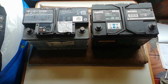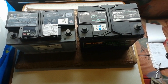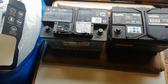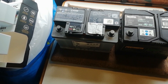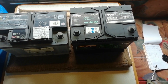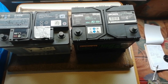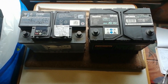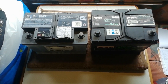The answer is that the car battery is more like Usain Bolt, whereas the leisure battery is more like Mo Farah. The car battery is designed to kick out a lot of energy over a short period of time while cranking the starter motor, whereas the leisure battery is designed to put out much less energy over a much longer period of time while you're relaxing in your van with lights on. In a nutshell, that's why you can't use a car battery in your van — well, you could, but only for very short periods of time.